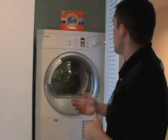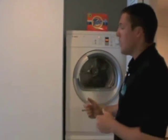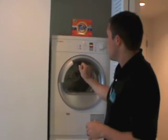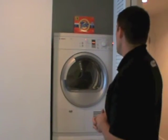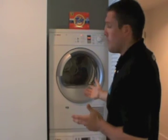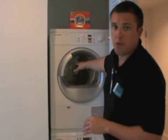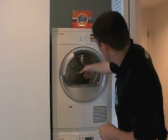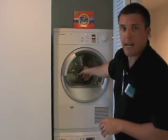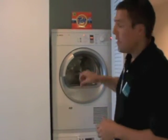A common mistake people make is they see two hours and seven minutes and try to overload the dryer with too many clothes — it actually works against you because if you overload it, the air can't pass through your clothes and you can't get them dry. So don't be fooled by this time when it first comes up. Usually I tell people when you put your clothes in the dryer, don't fill it more than about half to two-thirds full. The center knob in the back is the halfway point — about two-thirds of the way is the max you want to fill it, so the air can pass through and dry your clothes efficiently.